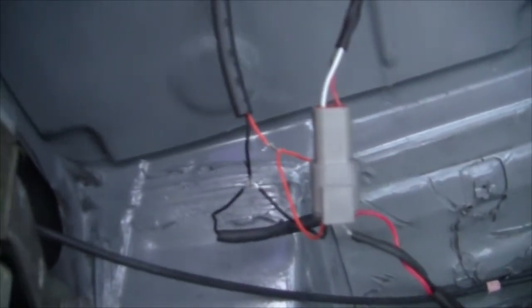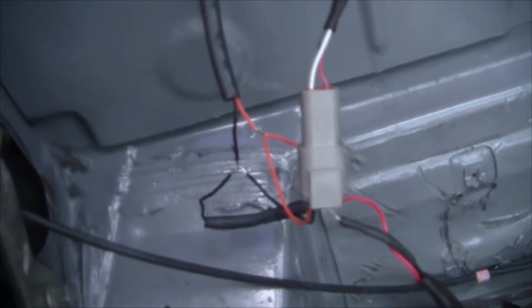Today we're going to try and fix the CAN Lambda. It's snowing even though it wasn't supposed to until tomorrow. I'm also going to go through the engine bay wiring — just trying to clean things up, get things tucked so it looks cleaner but stays serviceable. So re-wiring the CAN Lambda — excuse the shoddy wiring, this is literally for testing and troubleshooting. I actually forgot the issue: the relay this is connecting to is not functional, so I need to get a new relay and then hopefully this will be able to get power and we'll get this thing hooked up.